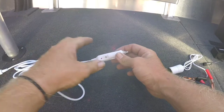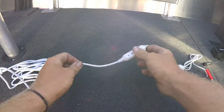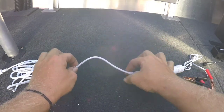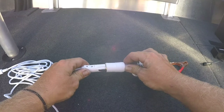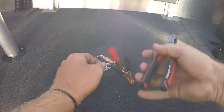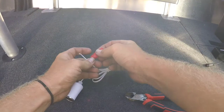What I was going to do is hardwire this straight in, but I'm going to keep this because it has an inline fuse up in here. You can still chop this, but all you're going to want to do is just install a separate inline fuse and then put your connector on the end. I'm going to keep this just to make it a little bit easier connecting and disconnecting if I need to. Get yourself some snips, cut one, cut two, get rid of them — we don't need them.